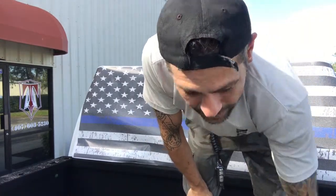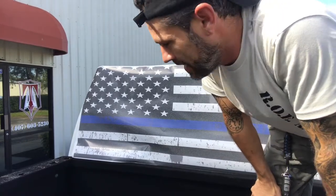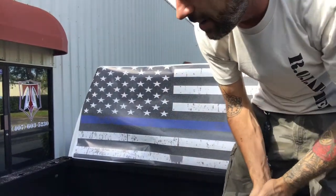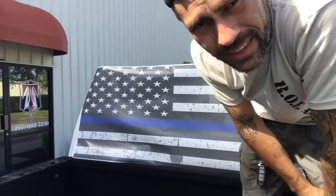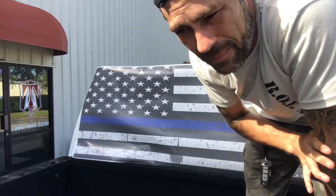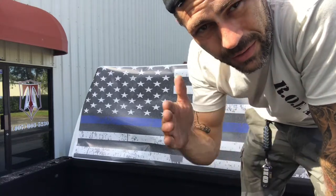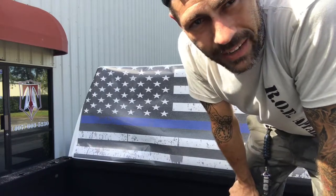So we just kind of place it in as best as we can within the composition, basically. So now that we have that in there, we are going to start peeling off one side and laying it on. Now, because the window's trimmed, you do not cut the vinyl before. You do it as you go, basically. And it will fit right in, especially since there's about a border that thick around all the windows. You have plenty of room for it to push in without it not being enough vinyl in that area.